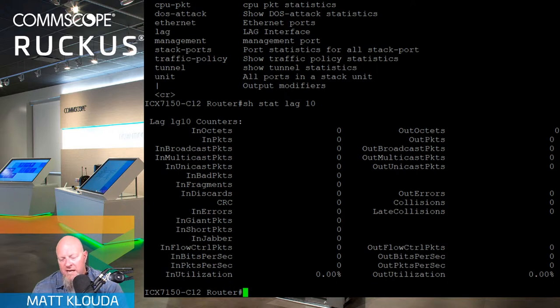If you have more than one access point in your house, I would strongly recommend that you change your BSS min rate for your WLAN. And what that does is it tells clients, your phone, decide when they roam. The access points don't decide that. And the clients decide that based off of what their connection strength is to it.